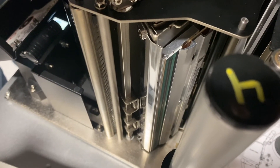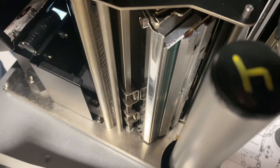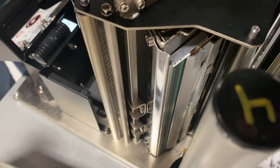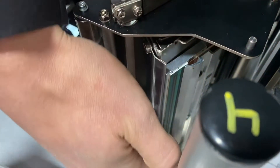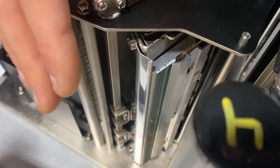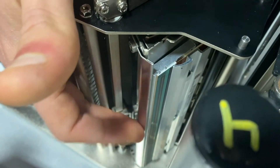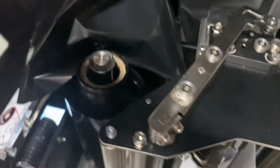If we get around to this side, you can see the printhead is green and black. If we ever see a lot of white wear and tear, there's a good chance that printhead will start to fail pretty soon. Just be conscious of that. I could take a Q-tip or a cotton swab with some isopropyl alcohol, rub the printhead down, make sure it's nice and dry, and then run again if it's getting dirty. If we're using a white ribbon, you'll find that we're getting dirty faster than using a black ribbon.